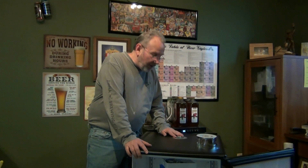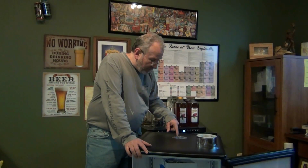After taping from the top, take a look from the inside of the refrigerator. I found 2 positions that would benefit from another piece of tape. In addition, since this is 2-inch wide aluminum tape, I went ahead and ran a single piece around the inside, removing edges and strengthening it. Aluminum tape can get damaged and break. The overlapping and the additional piece ensures that this is going to stay secure and the insulation won't be damaged in the future from moisture.